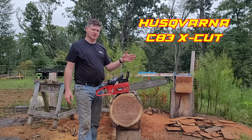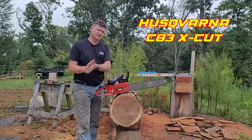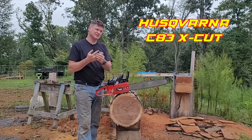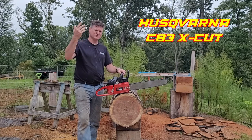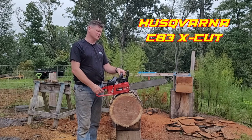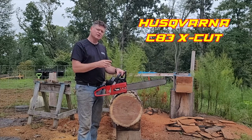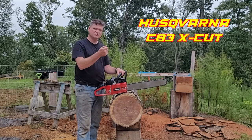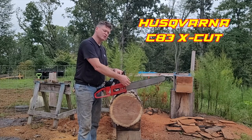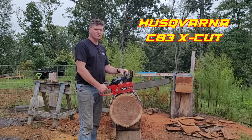That's the fastest chain you can get. However, it slows down about 10% as soon as, maybe not quite that much. Yeah, it's about 10%, because I did a test. It's on my channel. I tested all the chains side-by-side comparison. It's about 10% slower than out of the box as soon as you file it, because you can't replicate the angles that they put in there from the factory. The only way to get close is to actually do a square grind.